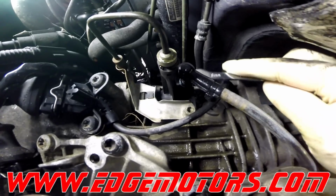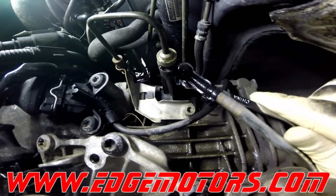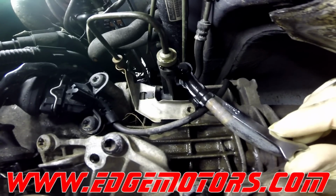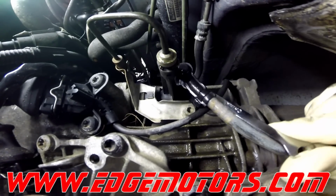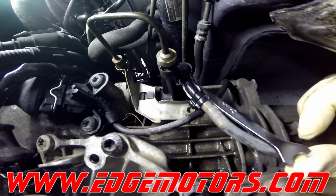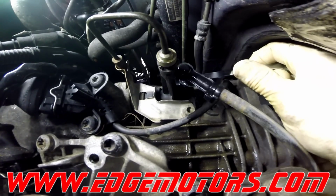So here you go. Oh, press. Release, press, release, press, release, and so on. Constantly check the fluid level so you don't get new air into the system, otherwise you're gonna be bleeding it like that forever. Press, release, press.